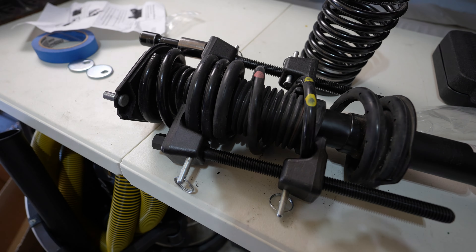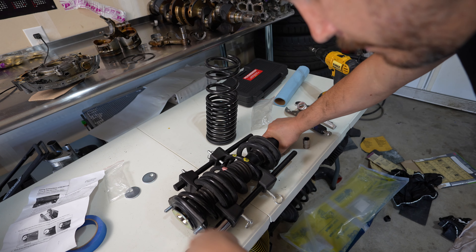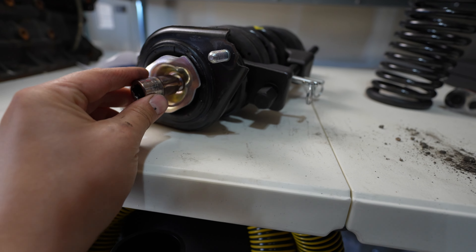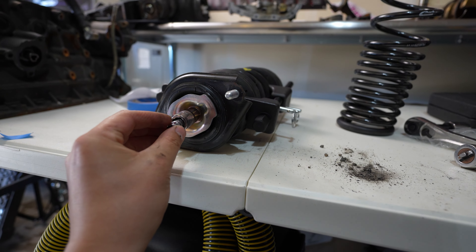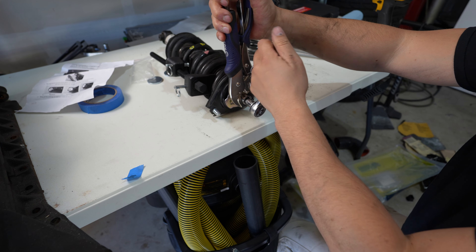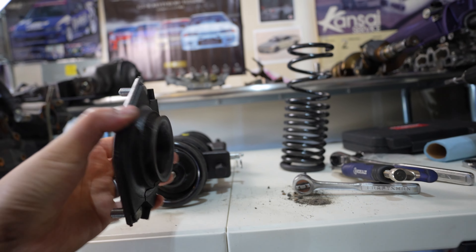We have our spring compressors on here, so work these side to side slowly and make sure your hands are out of the way of the springs in case one lets go. I'm going to hold on to the bottom where my hand will be safe and walk this nice and slow all the way off. The springs are loose — there's also a tool with an open wrench socket that allows you to put an Allen wrench in there. I'm using a 5mm hex head with vice grips — righty-tighty on the wrench which is lefty-loosey on the socket holding the nut. Now it's nice and loose and we can twist it right off. The top hat comes right off.